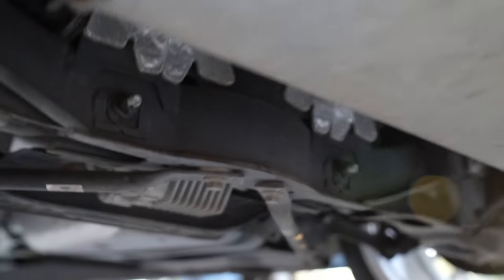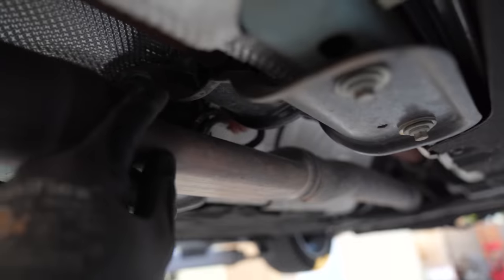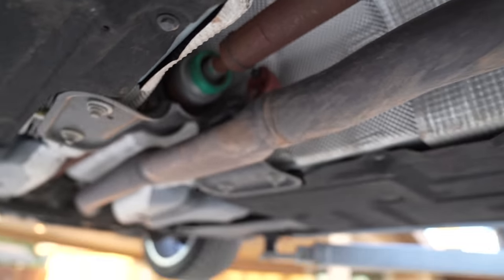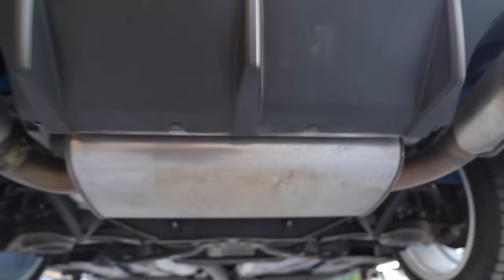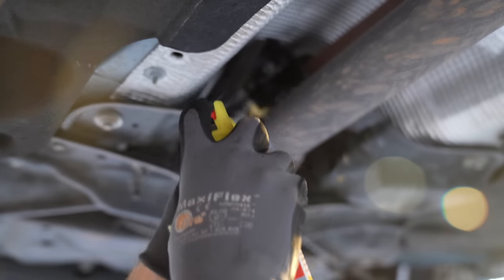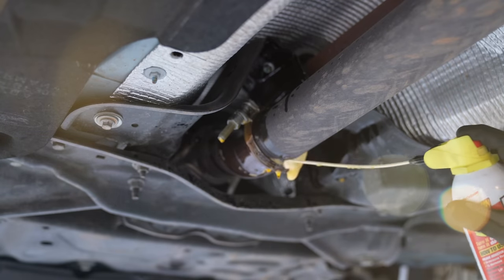Under the car we have the stock actuator. We're going to have to cut the exhaust right here. Look at the shape of the pipe — it's like a little triangle, making space for the driveshaft. There's a cute little v-band; hopefully it comes off without breaking. I'm going to get everything soaked in PB Blaster penetrating lubricant so it all comes off a little easier. I don't fully trust these things on Fords.